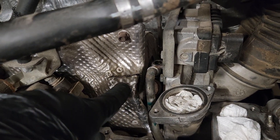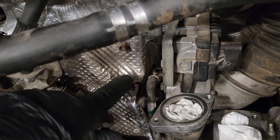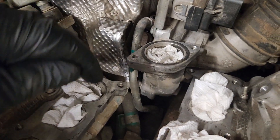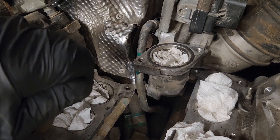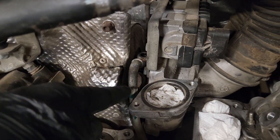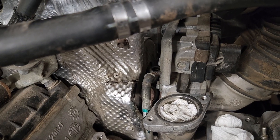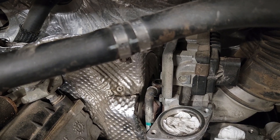I've already destroyed this and it doesn't move that well. I might have to bridge that with some kind of flashing or something, but I think we're just gonna go buy some silicone tubing — some 3/8 high-temp silicone tube and replace that. Look, it doesn't budge. There's no way you can get a socket around that banjo bolt behind it. It's not possible. I'm just gonna go find some high-temp hose tomorrow and replace this guy here.